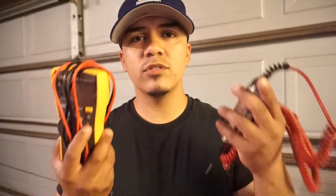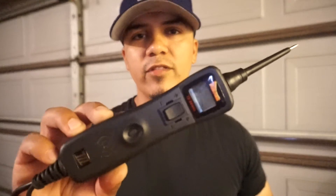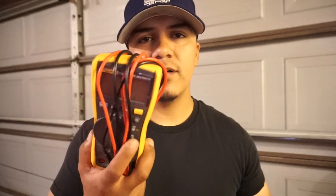You can get a multimeter that does duty cycle and pulse width modulation, which is going to be more expensive. This one ran me maybe 150 bucks or less. The multimeter, the test light, and everybody's favorite — the power probe — because you can make windows go up, door locks, lights, horns, wipers, whatever you want to activate at the touch of a button. But if you know how to use a multimeter, you can do it too. You can even do it with a test light, but you've got to be very careful. The power probe does have a circuit breaker built in.